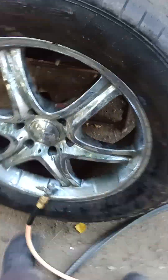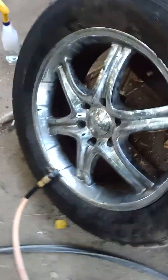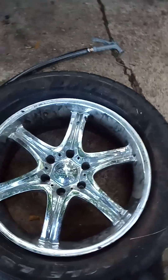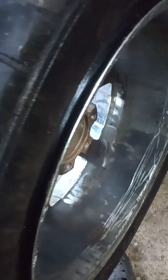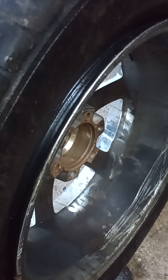This is a 20-inch tire on this rim and I'm about to mount it, put some air in it, and call the customer so he can pick it up. So you see what I just did — I just kicked the back of it. When you do this it makes the back side of the rim catch with the tire. See that gap right there? Sometimes you have to push the tire in from the back so it can catch air.